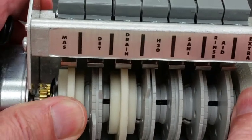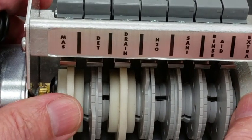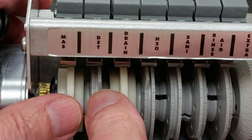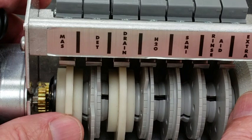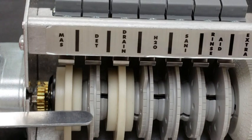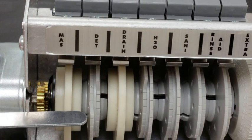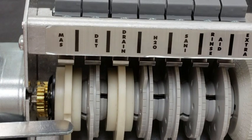This is done by trial and error to see how many milliliters are dispensed into your tank at the different settings. The strength and concentration of your detergent will determine how many milliliters you'll use on each rack. Be careful when adjusting the detergent that it does not come on before the switch comes up out of the on-off notch.